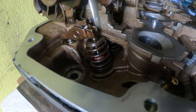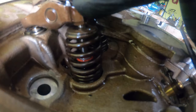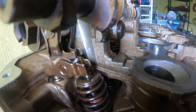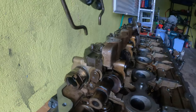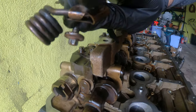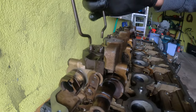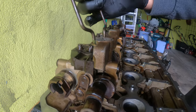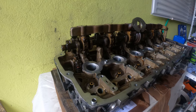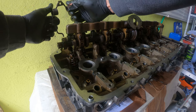Okay, well now we're going to try and put back on the springs, the same method that we took them off. So at the back here, you have this tiny little tab that the end of the spring fits in. So what we want to do is try to wrap the spring around all of this stuff, sit the spring down in here with this piece facing where it's supposed to screw in, and then we're going to put together our improvised tool again to try and cinch it down and then put the screw back in its place. You may want to ask somebody for help here, just so that everything stays together nicely.